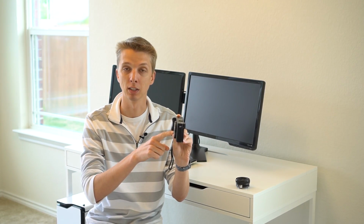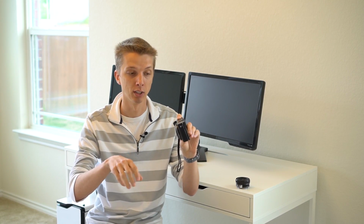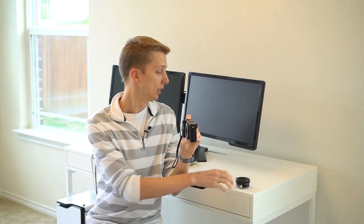So there are three methods that I would recommend if this happens to you, and I'm going to go over all three of them in this video right now. The first one is the easiest: take your A6000, take the lens off, and then use one of those blowers and you blow air. You never want to blow using your mouth into the sensor area, because saliva particles will blow into there and you may ruin it. So you want to blow using not a can of air, but just a hand blower, and tilt it upside down, blow in there. Most times that will free up whatever dust particles are stuck to the sensor, and they will fall out and you'll be fine. If that doesn't work, there is a cleaning mode built into the A6000.